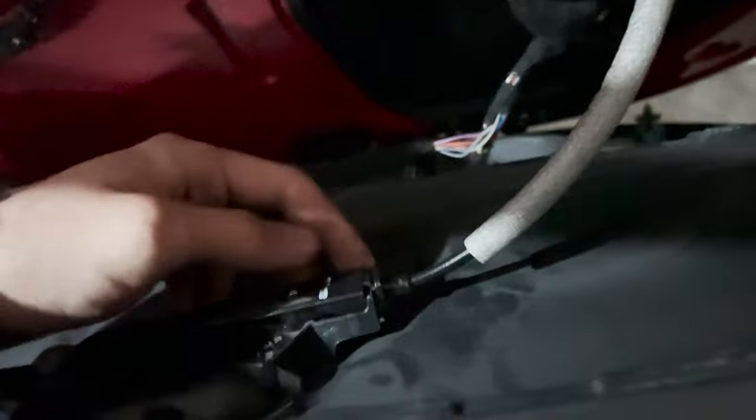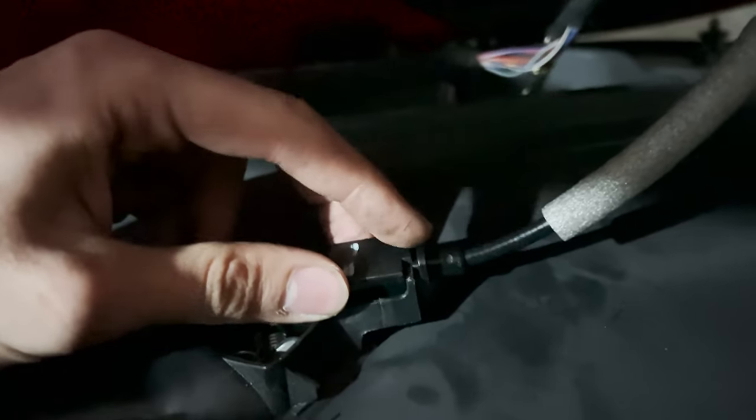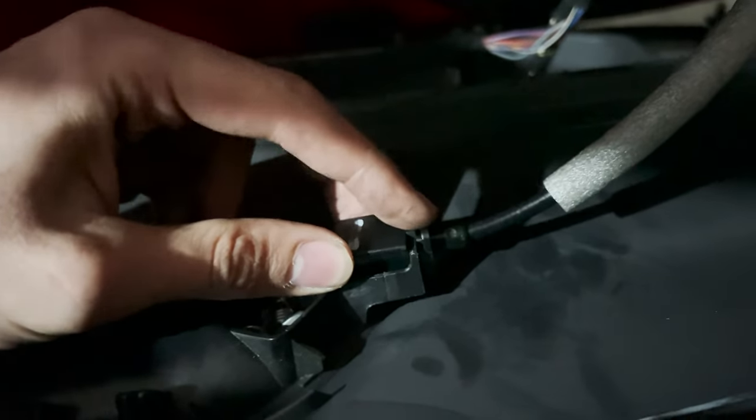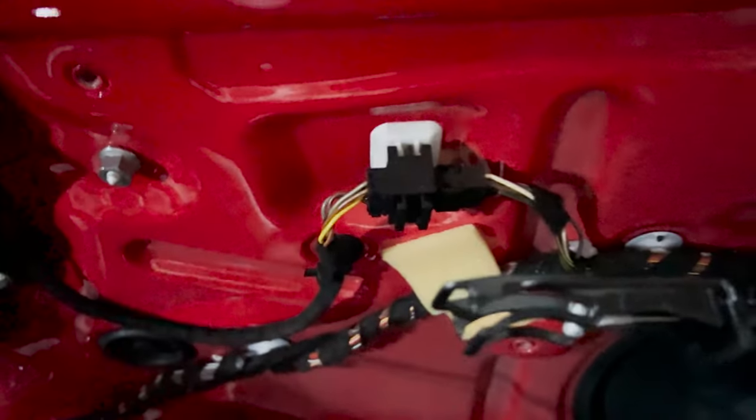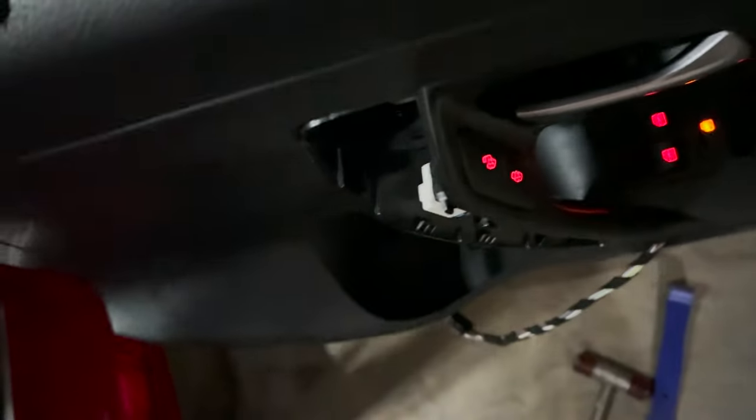Here you'll deal with this, which will be dangling onto the door right now, and that's what's holding it on in an awkward position. To remove it, just take account of this tab, push it forwards, and you'll be able to lift it up, and the cable will just pop out from its hook. And from now you can remove the connectors to get access to the connectors that we need, which is this right here, and there's another one on this side.